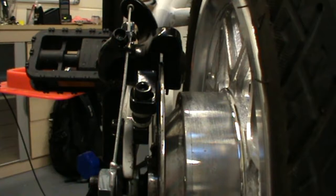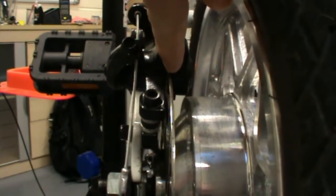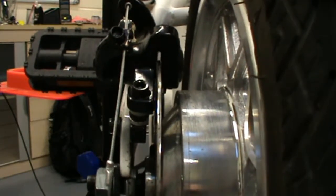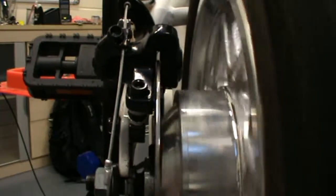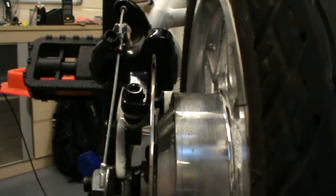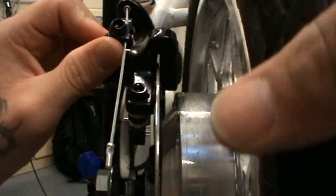What I'm going to point out here is very subtly — you can just see a little bit of daylight on the inside of the brake pad there, just to the left side of the disc. You're trying to make the wheel pass through the caliper without it rubbing or dragging or causing any issues. There's enough clearance here on this disc. If I pull the brake slightly, you'll hear what a rubbing disc sounds like.